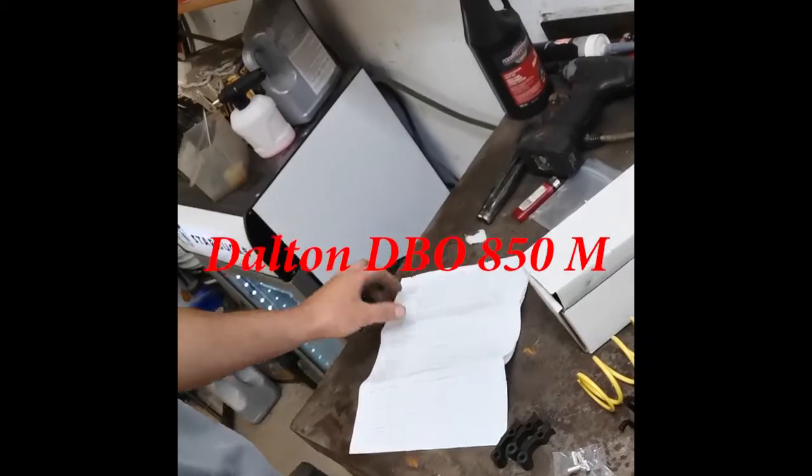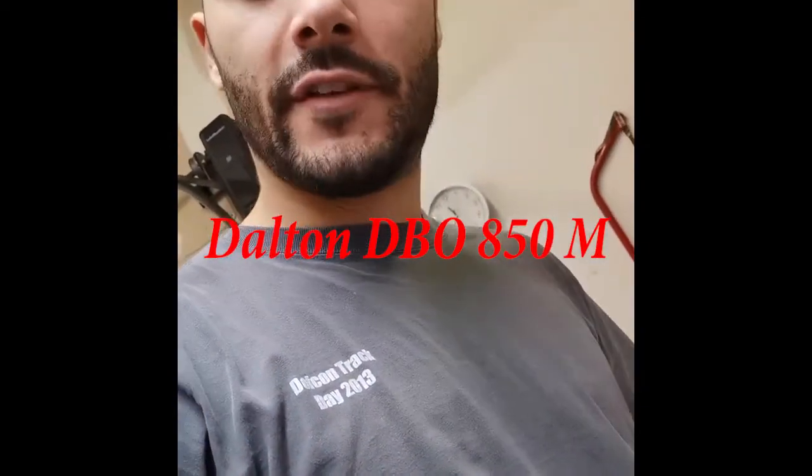So now it's my job and my task to do a clutch kit on this thing today and a lift kit. But right now we're gonna start off by doing a video of the clutch kit. So the clutch kit we're gonna be using today is a Dalton Pro clutch kit, part number DBO850M, and it's for apparently multiple models from what I can see from reading so far the instructions. But we're gonna dive in and we're gonna show you primary spring, secondary spring, as well as changing the ramps or the flyweights and the actual weights themselves. So let's get to it.